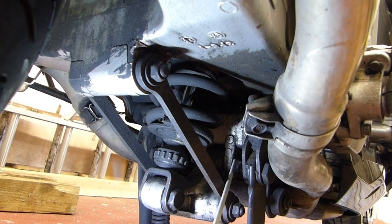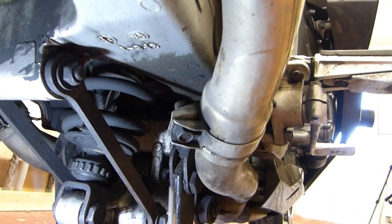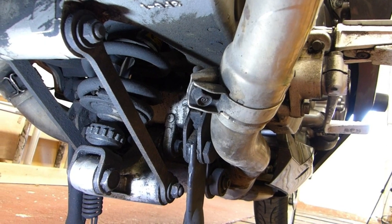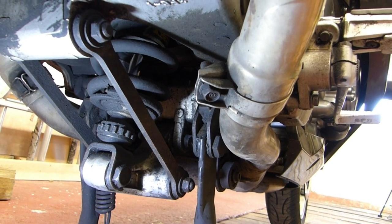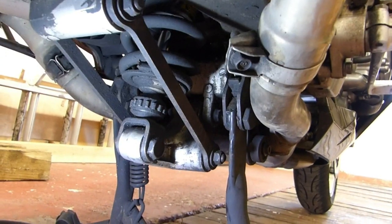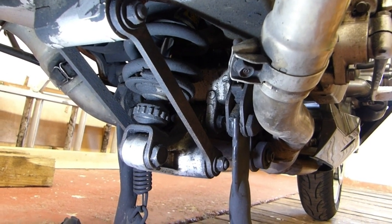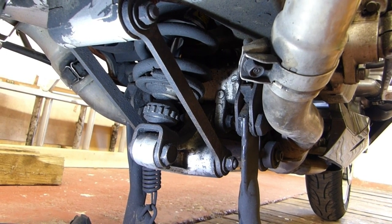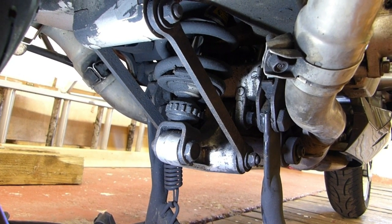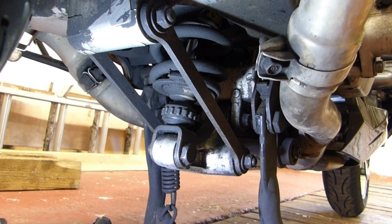The big problem is getting that bolt out. We can also see the center stand is in the way, so we cannot even get at this with the center stand in the down position. It can be done with it in the up position for these bearings, but we're still going to have to suspend the bike at some point. We can actually do this and this with the bike with the center stand still in position, and if you don't have a way of immediately being able to suspend the bike, I would recommend having a go at doing these before you try to get the center stand off.